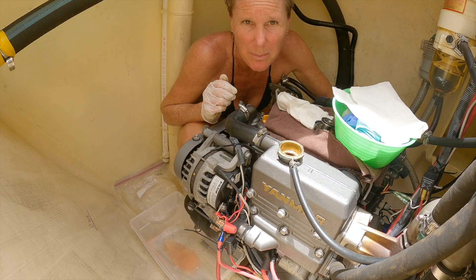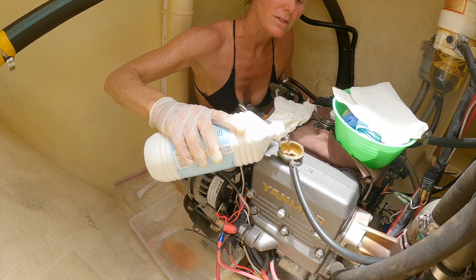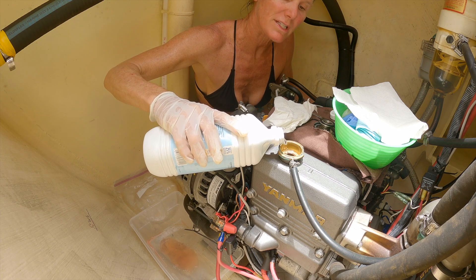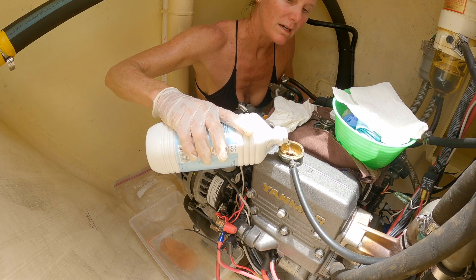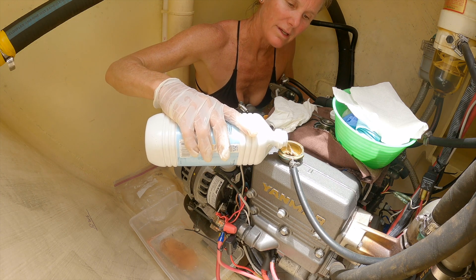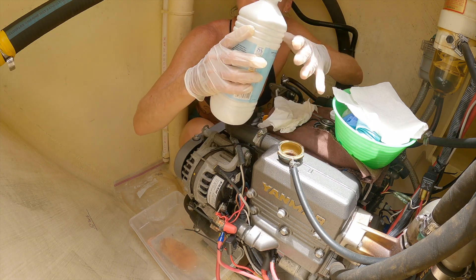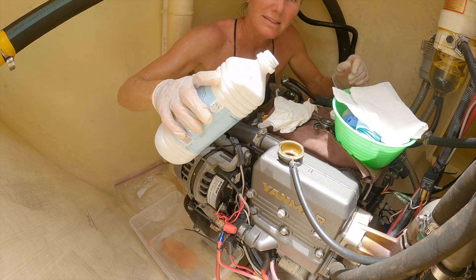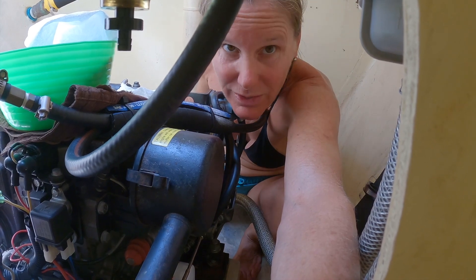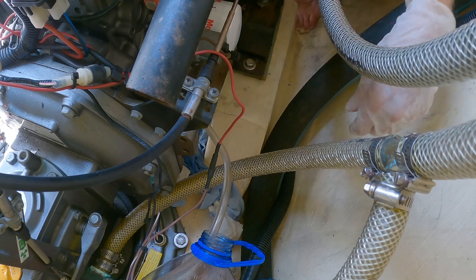Close the little caps back up. Now we're going to pour in some clean distilled water. I know you can run the engine and let this circulate through, but then you have to wait a long time for it to cool. Considering how clean the coolant was, Ryan and I are okay with not running the engine for the flush. Two and a half liters of distilled water went in and now we're going to flush — both ends. Both plugs are back in and tightened.